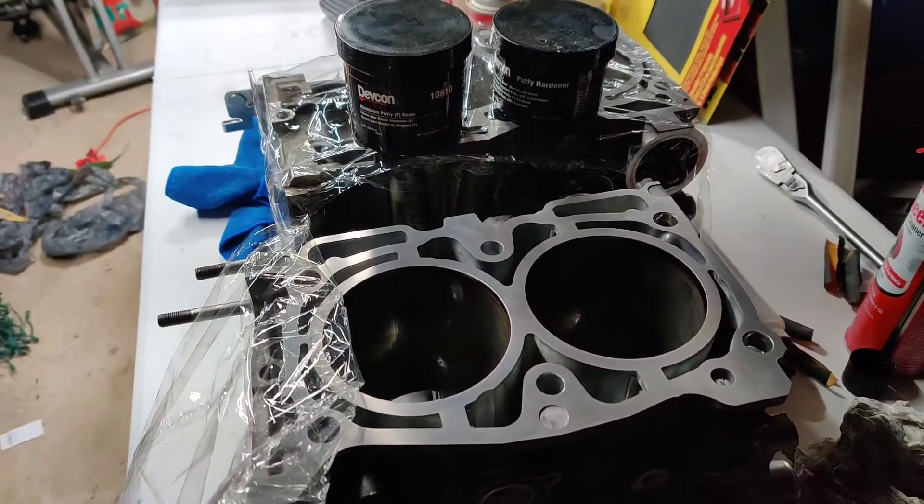Also to keep this DIY friendly, I am not gonna be using half-inch or 14 millimeter head studs in this block. I'm gonna be using ARP 625 head studs because those are head studs you can just drop right in without any machining. I had debated doing the half-inch, but I want to try and keep this whole project super DIY friendly. Also I don't want to invest a ton of money in this block, because there's a very good possibility that this is all gonna go kablammo when I crank up the boost.